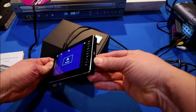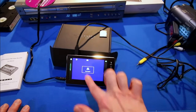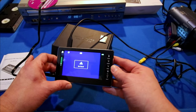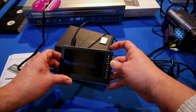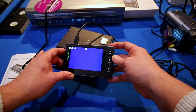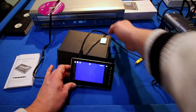Go ahead and insert the SD card. Because I'm about to record from my VCR into the system, it wasn't showing that it's been received, so let me go ahead and turn it off and turn it back on. Probably had to turn it off when I took the card out. So I do not recommend putting the card in with this unit turned on — you want to have it unplugged.